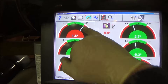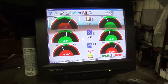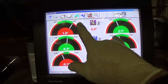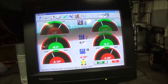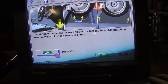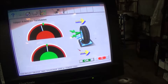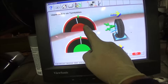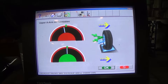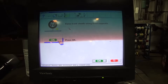All right, we can see our caster angle is off here on the left wheel. I explained back at the shop how we're going to do that using those cam bolts. The neat feature about this program is these are all live measurement screens - we could essentially just start making adjustments, but we can utilize the tool here. It actually has a control arm adjustment section that shows us adjusting our upper control arm on the right side - our front cam and rear cam - and actually tells us which way to turn the individual cams. What we want to do is make these adjustments in an elevated position, so we'll push the jack button. It's telling us to raise the wheel - it's going to retain our measurement and then we can make adjustments with it elevated.